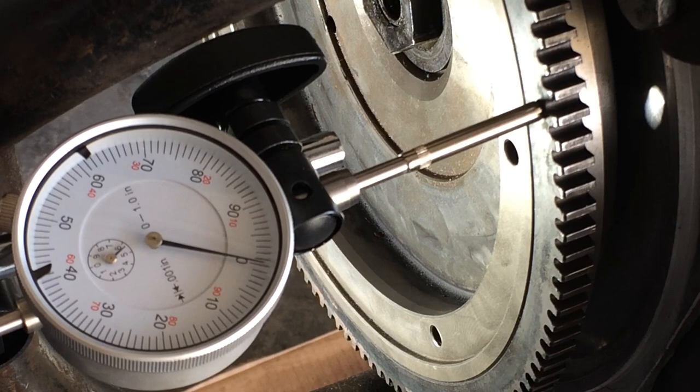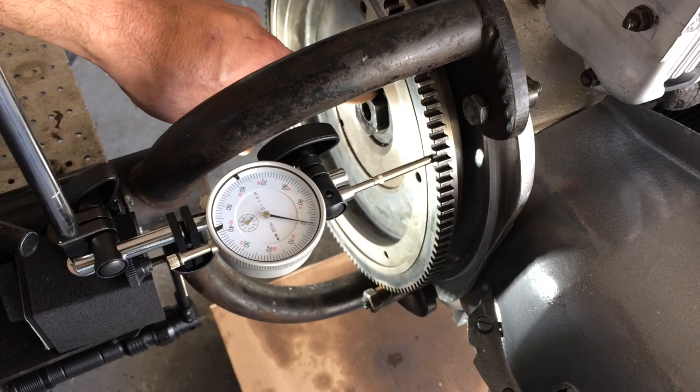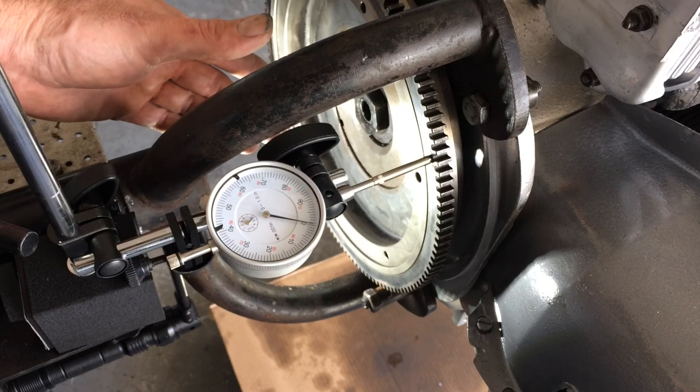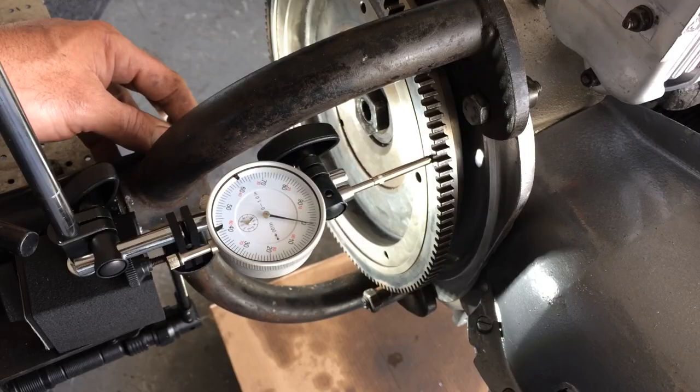Now what I'll do is, once everything's off the stand, I will go ahead and remove the chromoly gland nut. I will put the rear main seal on. Listen to my phone chime again. And then I will add red Loctite to the gland nut and torque it to the proper torque. And then put the clutch on. And then my phone rings.